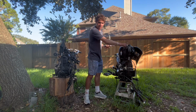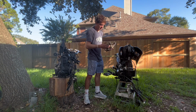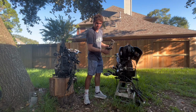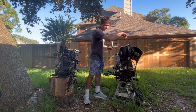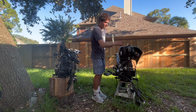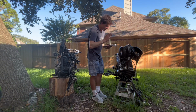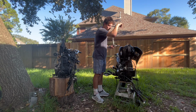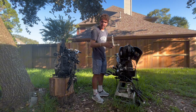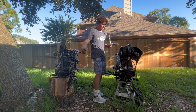Same on the Hawk. The Hawk and the Hawk 250X have different bearing styles. They have ball bearings. These are very different. These are rollers. So you're going to have to do the same thing on the Hawk X or Hawk 250X. You have to pop the race out, and punch in the new races. Again, everything is brass. I can't emphasize that enough. Brass, brass, brass.